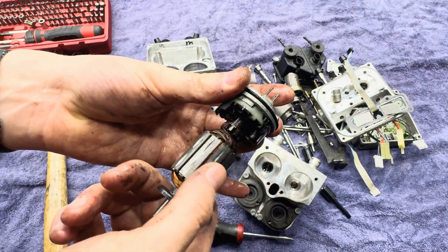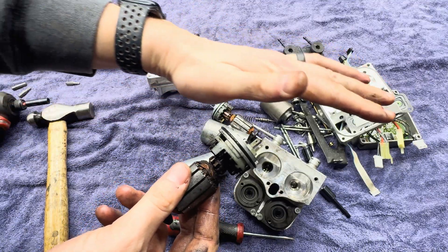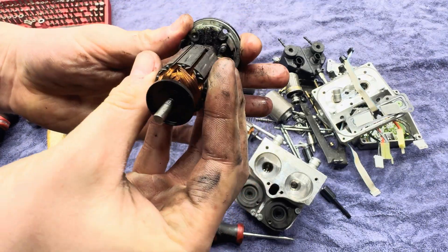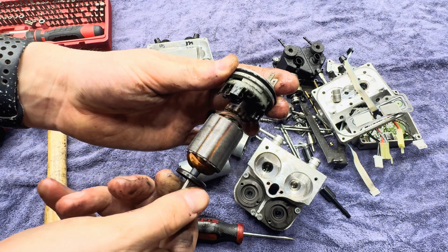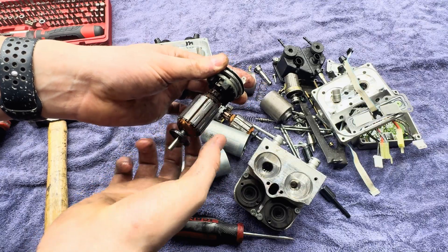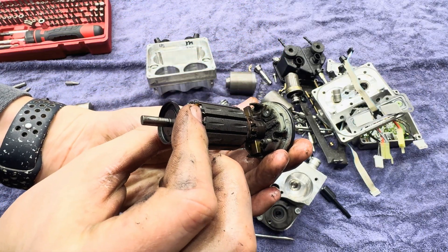What's likely going on is the brushes are bad and it just needs a new set of brushes. I bet you could take this apart without taking it this far apart to get these motors out and get these brushes repaired. It doesn't look that hard — it's just a standard electric motor, like a scaled-down version of what your starter motor looks like. Thank you very much for watching, and if you like my videos, please hit that subscribe button. Have a safe ride.